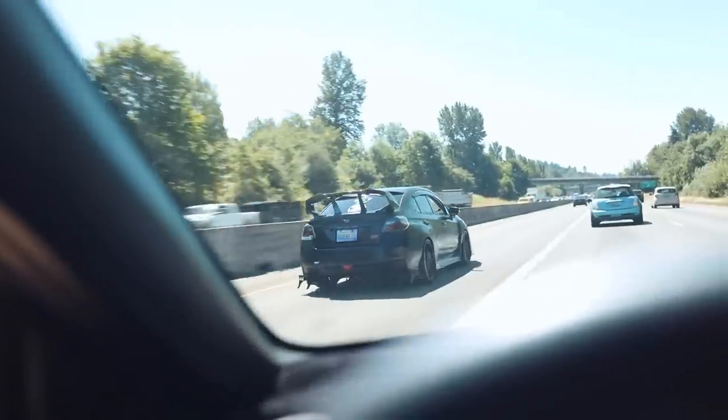Time to swing back down to the house and show you guys the vision — it's going to come to life, you're gonna love it. I've found the Achilles heel of Karma, which we're gonna fix in the rebuild. The cooling system: it's 100 to 110 degrees out, and just driving normally coolant temps were 208 to 210. Getting on the car they'd shoot up to 212, and I didn't really want to push past that.